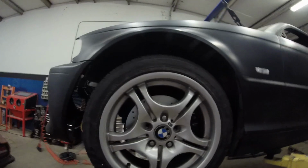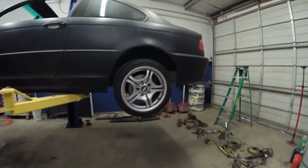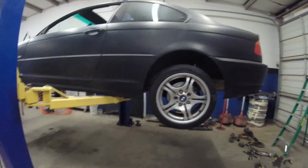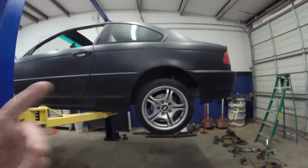And then also, if they say, oh yeah, go ahead and return it, then it sets me that far back on the car waiting for parts to come in. And it could take up to a month because they have to deal with the suppliers in China. So that's what I'm up against, but the front end's going to be easy to fix. We're going to get the adjustment on that. But I think what I'm going to do first is do the rear end, let it sit, see how far it goes down, take my measurement, and then adjust the front accordingly to what the rear setup is.